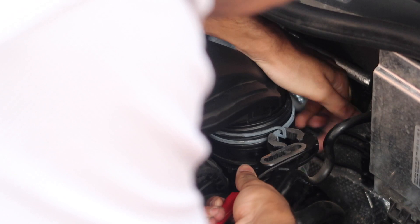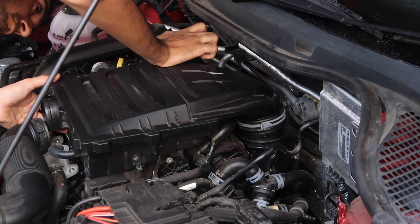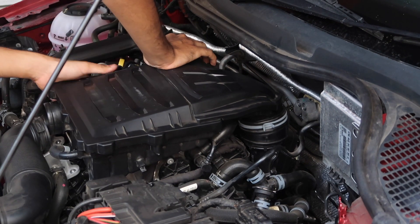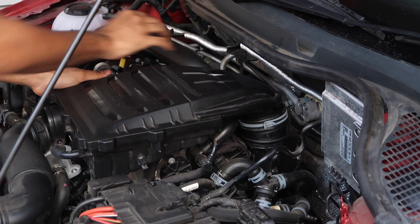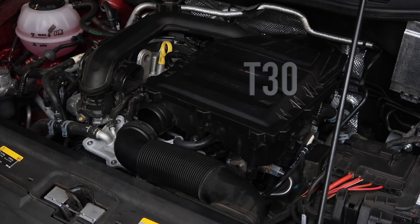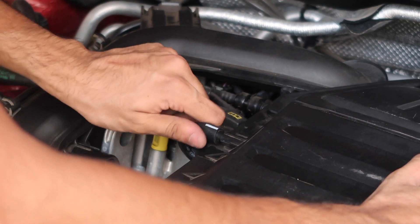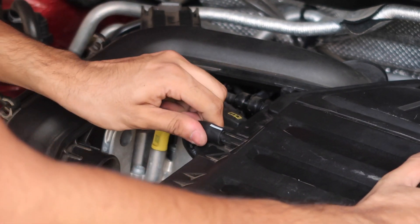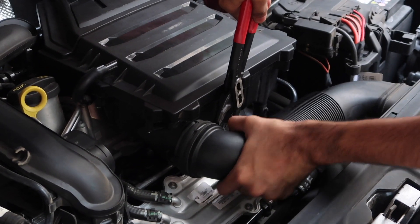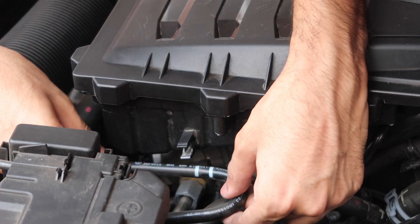It was the rear hose clamp which gave me a lot of trouble, so make sure you have a really good set of pliers. Then we press down the air box rubber mounts on the mounting pins, and once the air box is fit completely and properly you can tighten the T30 screw at the bottom. Next we connect the breather hose on the left — it even has a white marker on it to help you align it correctly. The only major hose left now is the outside air intake, which should slide right in on releasing the hose clamp.